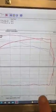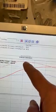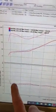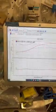You can see the difference — everything still pulls to 6,200 RPMs. You can see where everything crosses, where the peak horsepower is on the 483 cam right around four grand. You can see our fuel line — we've got a really good fuel line. The final run is the red run. Yeah, I think I'd be pleasantly pleased with this one.